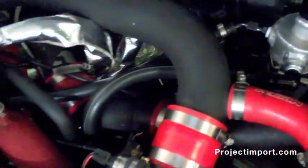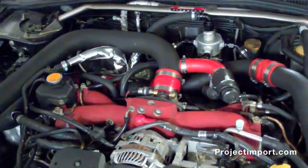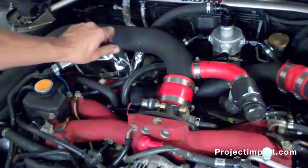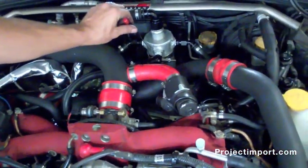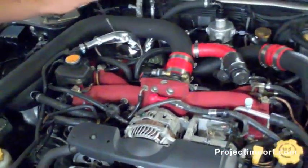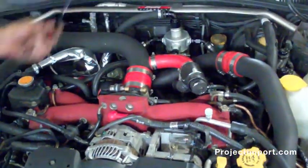Overall, if this thing gets oil in this catch can, after seeing that the car already supports its own way of keeping oil out of the crankcase ventilation, you probably have an engine problem. This port in the block now has to go through its built-in block catch can, up through this port, into this catch can, which also has a baffle inside of it that keeps oil from going into the intake side. Same thing on each valve cover — you have to get the oil up through the actual baffling plate, through the tube, into our Moroso can, and then back into the intake.